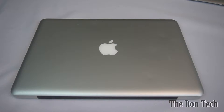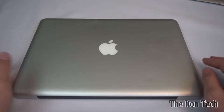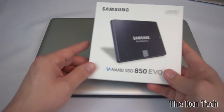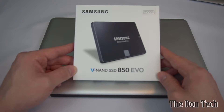This will primarily apply to people that have MacBook Pros from the 2013 or older generation. This one right here is about a mid-2012 generation, and I'm going to be replacing it with a 250 gig Samsung traditional SSD in just the standard two-and-a-half-inch format drive.